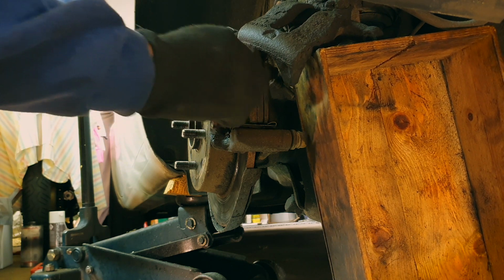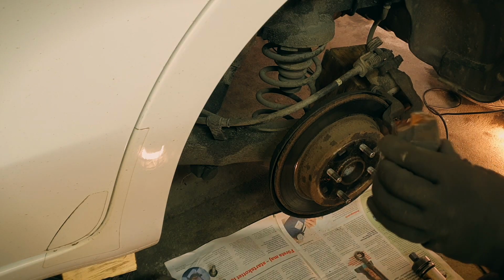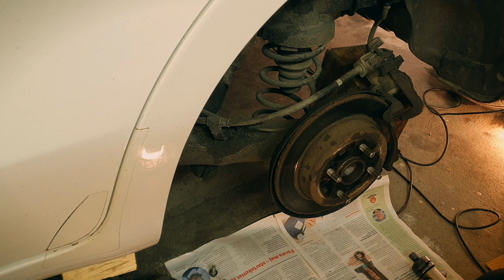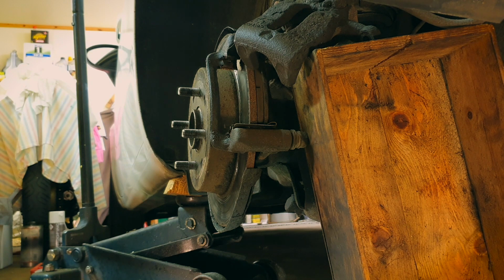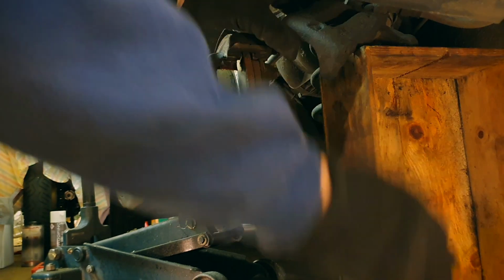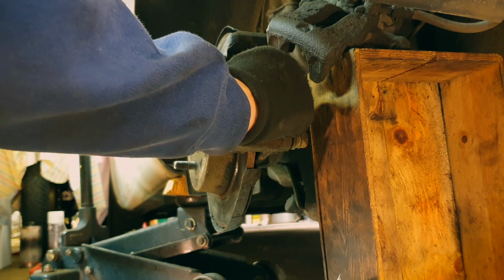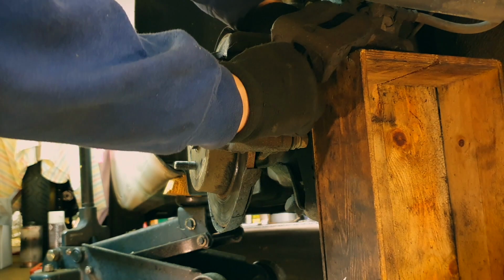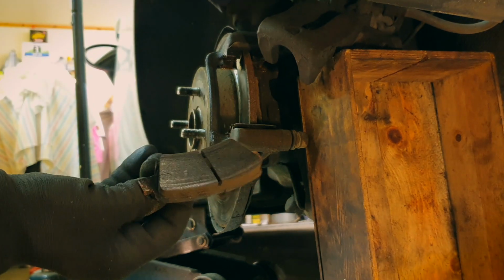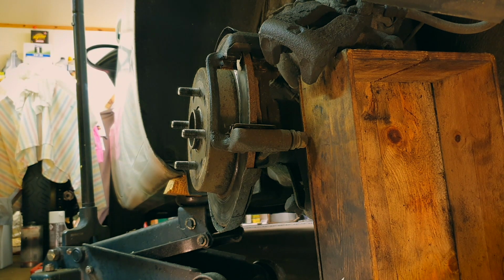Yep, they do. You see, I've already put a slightly small amount of high temperature grease, I think one should call it. Then, let me think. This one was on the outside. The other one. This thing isn't all that good. Why don't you want to stay there? Then the one on the inside. There we go. It's important not to get grease on the surface of the pad, nor the disc as such, of course. Yep, looks fine.